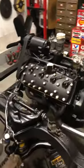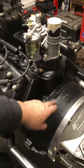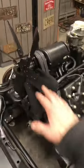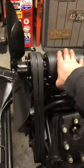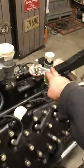This is the original engine. At some point they changed to a 59A block, which is the same. It has a '39 distributor on it, the dual truck pulleys, and the generator converted to 12 volts. I rebuilt the carburetor and got a new fuel pump.